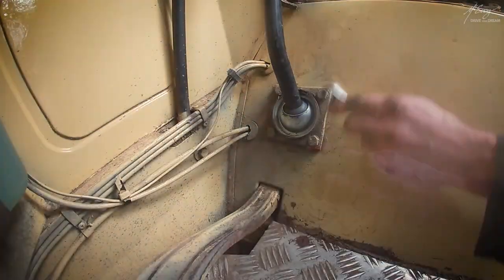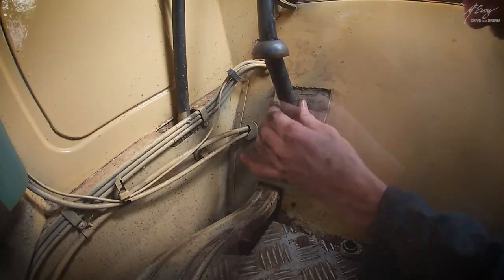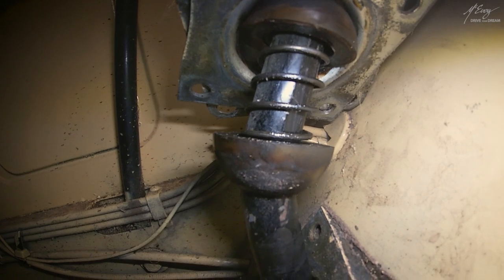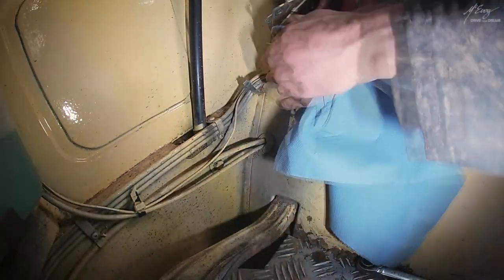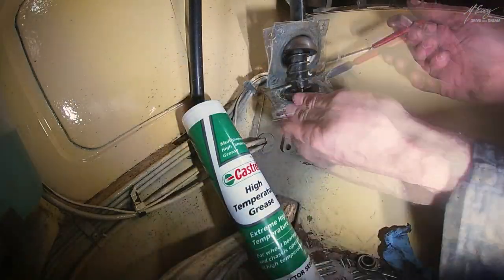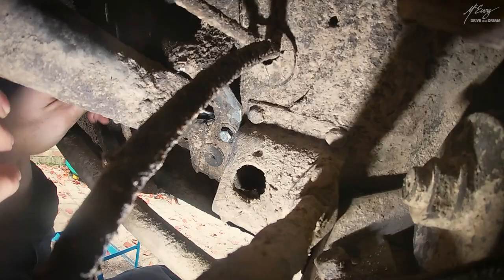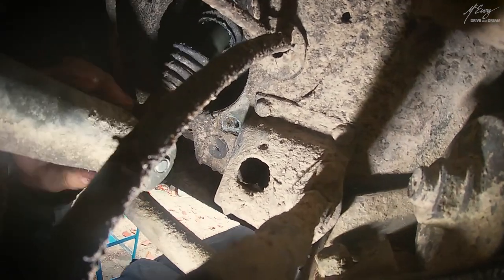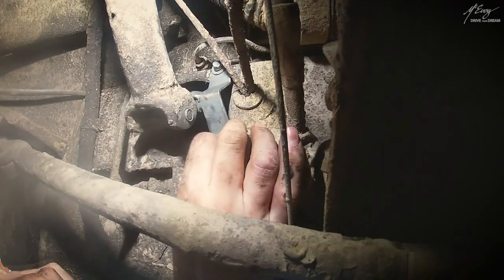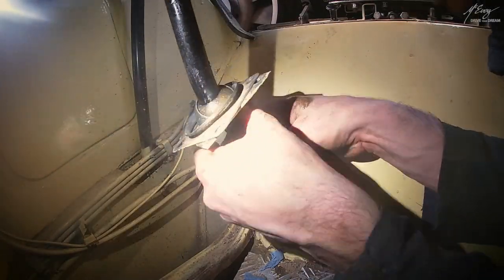Dismantling this piece, you really have to pay attention to how things are put together — it took me a while to figure it out and put it back together the correct way. This is just a matter of cleaning these parts and greasing them once more. There is a repair kit available; at the time I didn't think of buying one, so I just cleaned the fitment and greased it — but you can replace it and gain a little more precision. That boot there I still need to replace. The part that avoids inadvertent engagement of reverse gear while moving forward does need adjusting — we will take care of that in a few moments.